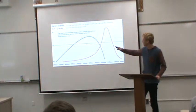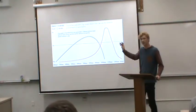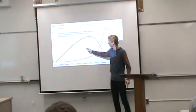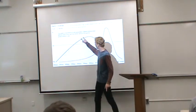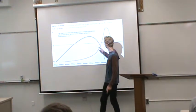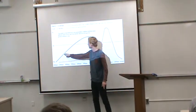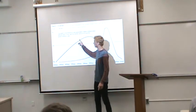So here is a diagram illustrating the power bands of a two-stroke and a four-stroke. And this black line is going to be the four-stroke. As you can see, there's a lot more power right here in the lower end of the revs, whereas a two-stroke is going to be all in the higher end. So you want to stay lower in your revs around here, so when you go out of corners or on straightaways, you have all this power to use.